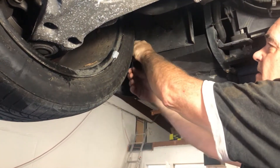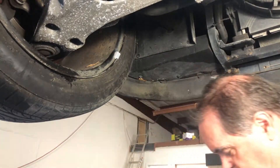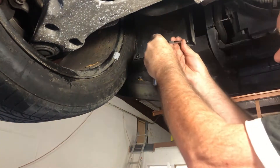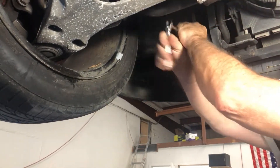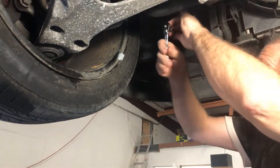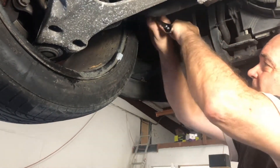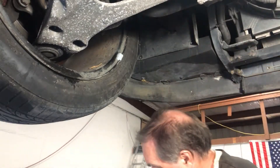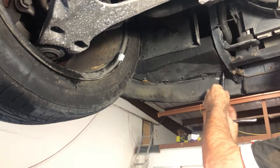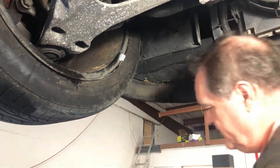Without a doubt, similar jobs on the Corvette are a real pain to do. Changing the front turn signals is one of them. There are two methods: one is to access through the headlights, taking off the headlight and cover and reaching down behind the turn signal. The other is removing the access panel on the bottom, which has two screws on the back and three screws on the bottom.